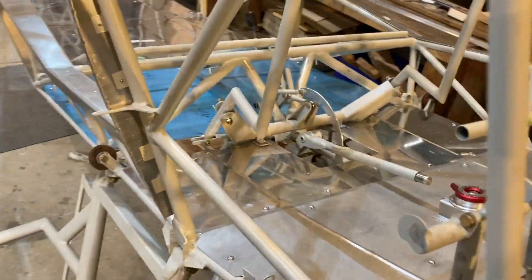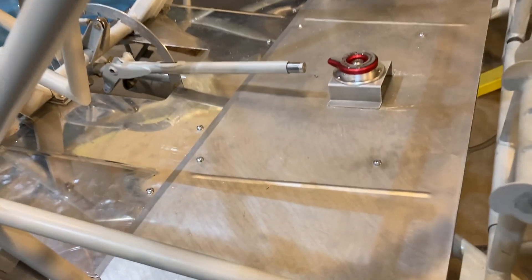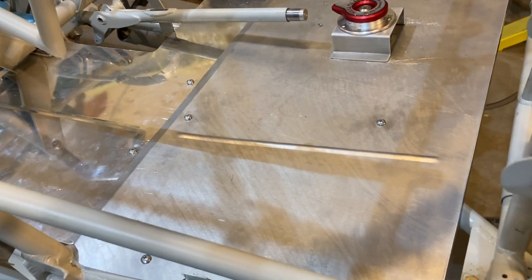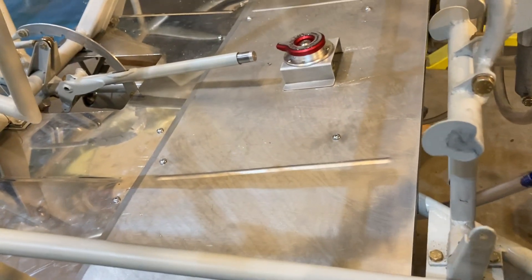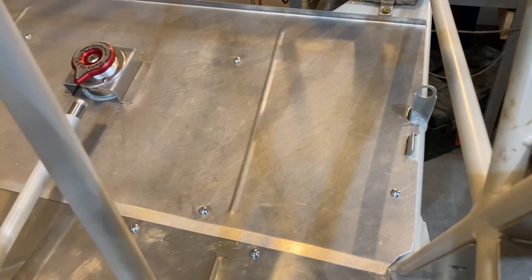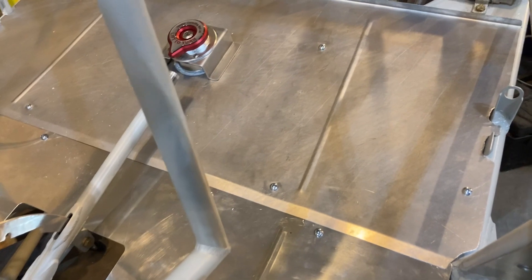For the floor, we felt it vibrated a little bit. So I used a bead roller and rolled in 3/8-inch beads to help stiffen it a little bit. I don't know that it was really necessary — we had the stuff to do it, it was not a big deal, it took a relatively short time, and it seems to have helped a little bit. We also used the bead roller to put a little lip on each of the overlapping panels so that as we screw them down, they'll tend to pull tight and not leave any gaps.